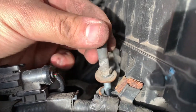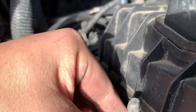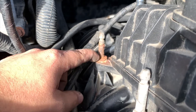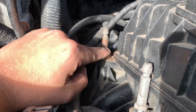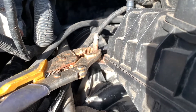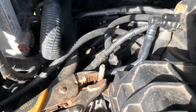I was able to take out one bolt, but the other one is rusty so I have nowhere to grip it. I'll probably use vice grips or some other way to get it out — just be careful. In my situation there was nothing left to grip thanks to the rust, but the vice grip idea did work. It's loose now and spinning, so we'll get it out that way. Fortunately I was able to get the other two off.